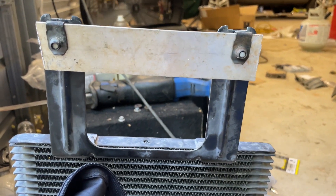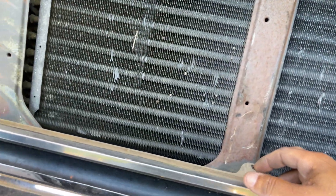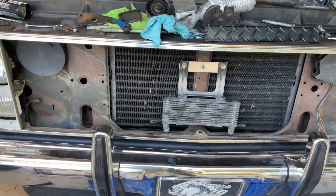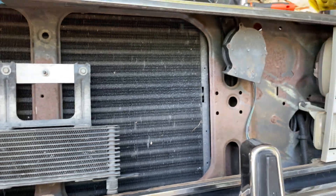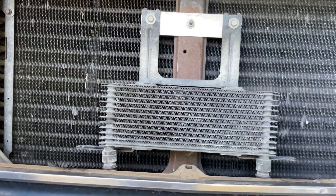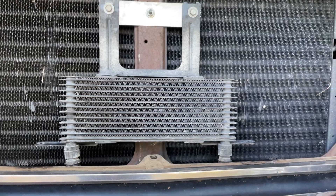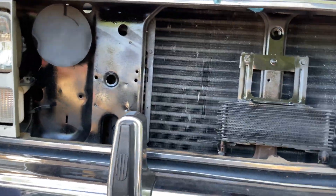I made a little mount for the transmission cooler. I'm going to mount it in the center - I removed the grill and I'm going to drill a hole right here and mount it to the center so it can sit right in the middle. I'm going to spray that mount up a little bit, get it mounted in, and put the grill back in it. I might go ahead and spray paint all of this black while I'm in here. Got it mounted. Just going to spray paint that bracket - and like I said, I might spray paint the sides over there also since I'm already in here before I put the grill back. Just drilled the center hole, put a 10mm bolt right there, and just got to connect it from the bottom. Did a little touch-up with the paint to make it look a bit better than it did with all that rust. Getting ready to put the grill back in now and connect the hoses.